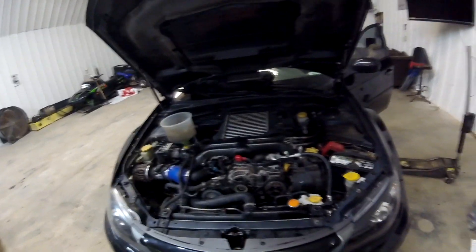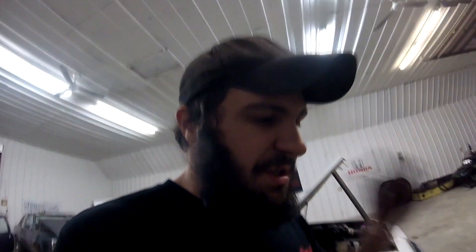So I got the old timing belt out of the Subaru and now the car's running. I got everything installed back on the car and I'm just bleeding the cooling system. There are some really good videos on this process — Speed Academy did one and Gears and Gasoline did one. Just make sure all your marks are lined up when you put the belt on and there's no excessive slack anywhere. It actually wasn't that bad of a job, and it sure beats paying somebody to do it — I'd guess this would have been about a thousand dollars at a shop.